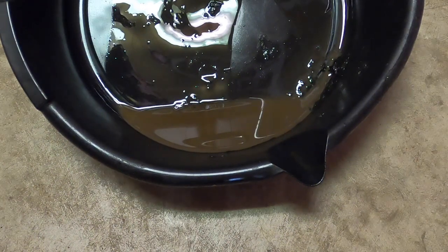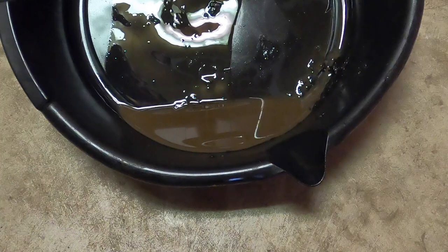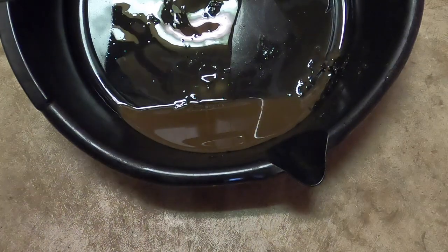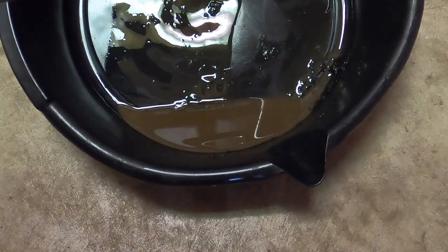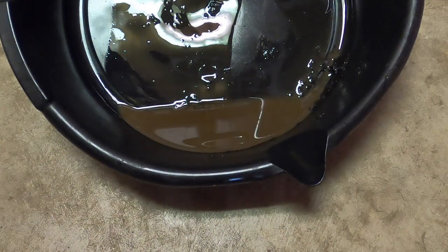If you see this, it's because there's water that has gotten into the crankcase and mixed with the oil. When you turn it on, it just becomes foamy. There is another reason why, but it's very, very rare so I'm not going to worry about it. How does it happen?